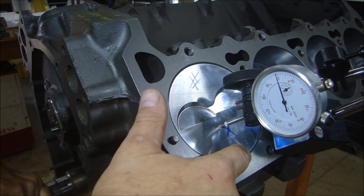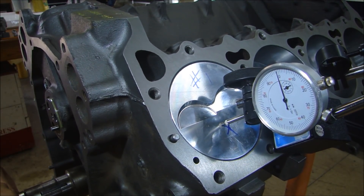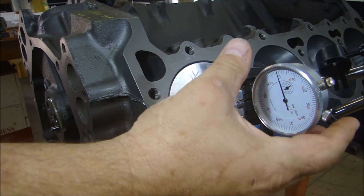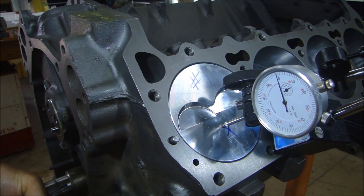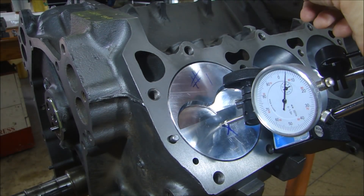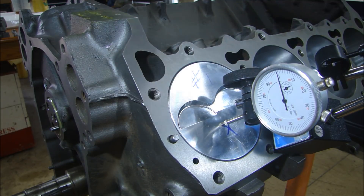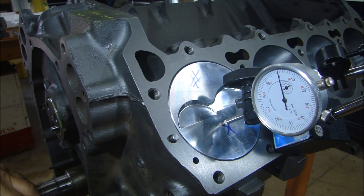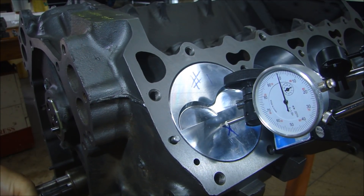This process is fairly simple. I have the number one piston just below top dead center, and I'm going to bring the piston around with my crankshaft until I get my indicator to move. I'm going to stop it as close as I can when it stops. I'll zero out my gauge. Close to zero — now I'll back up, and it just moved a little above.